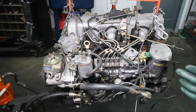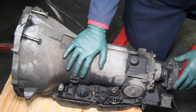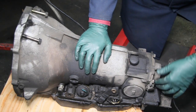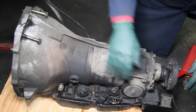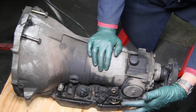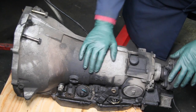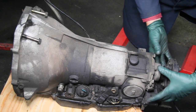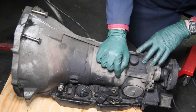Now let's talk about the transmission, because there's quite a difference between the two. The transmissions between the W126 and W123 turbo models are basically the same, but there's one very important difference: the speedometer pickup and sending unit located on the rear housing. The 300SD uses an electronic speedometer, so it has a totally different electronic pickup arrangement, whereas the W123 has a speedometer cable that screws in. You can't just take a W126 transmission and put it in a 123 or you won't have a speedometer. However, I have successfully removed the entire rear plate and all the gears off one and put the other one on to make the swap.